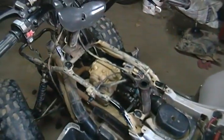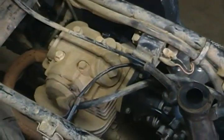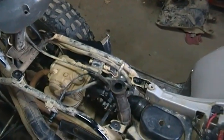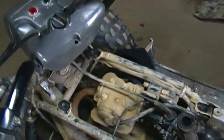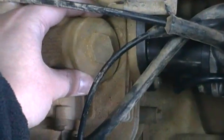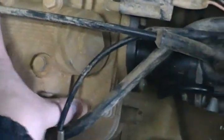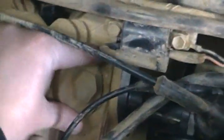Plastics are over there. The carburetor is not the problem, most likely. Either it's bad rings, or the valves need to be adjusted, but we're going to go for the valves. We thought maybe we'd have to take apart the motor, but further digging on the website showed that these right here are valve adjusting covers, so you just take this off and you can adjust them. You don't have to rip apart the block or take anything apart — you just take a nut and take this whole disc off.